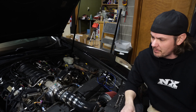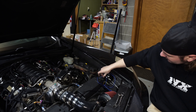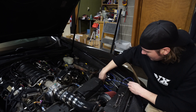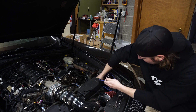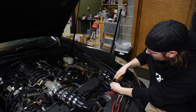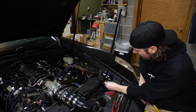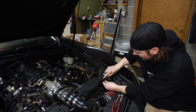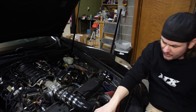I've got my purge wires ran up from the dash — plenty of length. Let's go ahead and talk about wiring the solenoids. We're going to do common ground, and I'm just going to go down to a frame bolt right here for the ground. Whenever it comes to things like this where you're using ring terminals to establish your grounds, make sure you're using the proper tools. It's very important to get a good crimp on there — using pliers or needle nose is not a good crimp. Go out and get yourself an actual pair of crimpers. That way you know you're going to get a good long-lasting crimp that has good continuity, because ground continuity is everything.